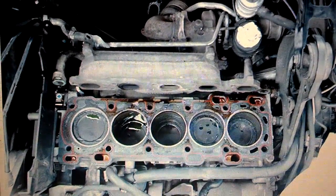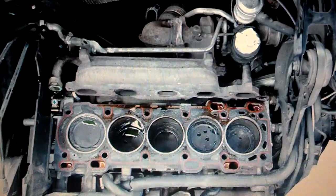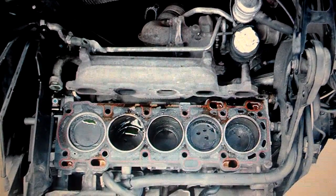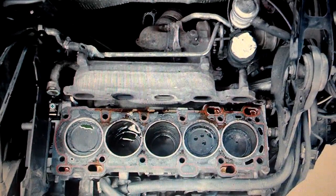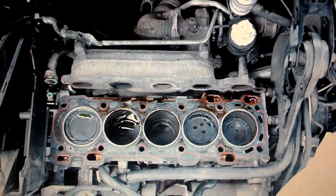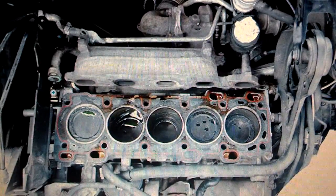Now it's time to clean everything up and get the block ready for the new gasket and the head to go back on. I got the turbo intake stuffed with a rag. My gasket came off pretty easy because it was probably only on there about four years. You also want to check your exhaust manifold real good — make sure it didn't crack. Mine was cracked but I didn't see it until I was going back in. This would also be a good time to replace coolant lines on your turbo and the coolant lines running behind the motor. When cleaning your block, do not use Scotch-Brite scouring pads — they leave microscopic particles in your motor that can destroy it in a matter of a few hundred miles.